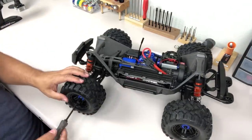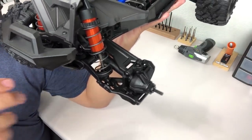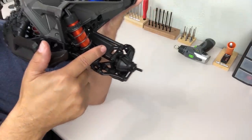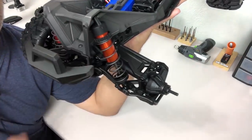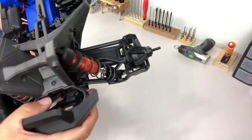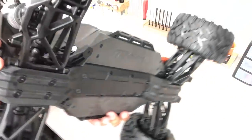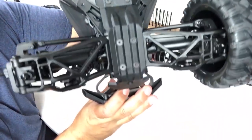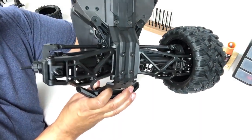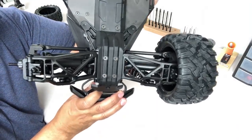Taking off the front wheel, we can look at the front suspension. The hinge pins are all captured, and you've got plenty of beef on the steering arm and the C-hub. You have a one-piece upper arm, and the steering linkages are also fixed length and one-piece. The truck is designed to be as simple as possible as far as maintenance and adjustments go. You can also see how the arms have very broad bases where they attach to the truck with plenty of reinforcing structure, and they're all open so they don't collect dirt and debris, which also lets the arms flex for more durability.